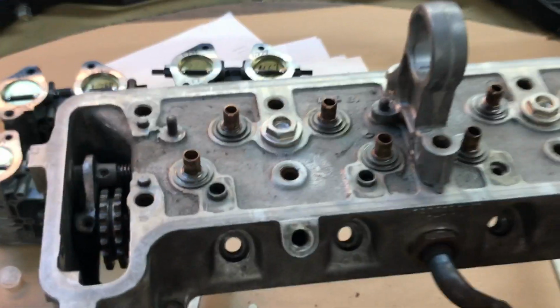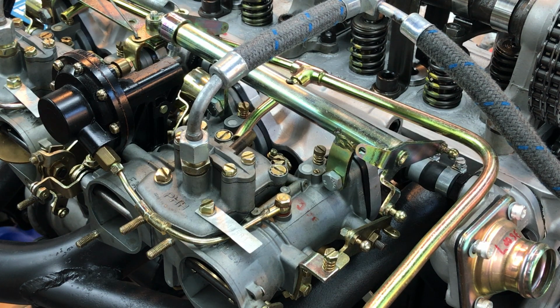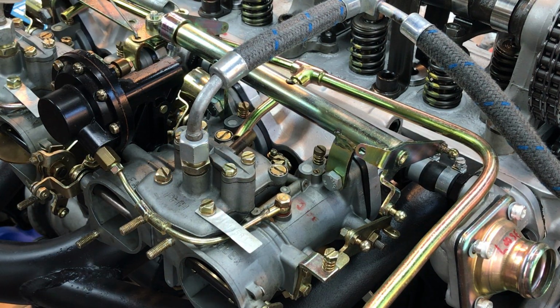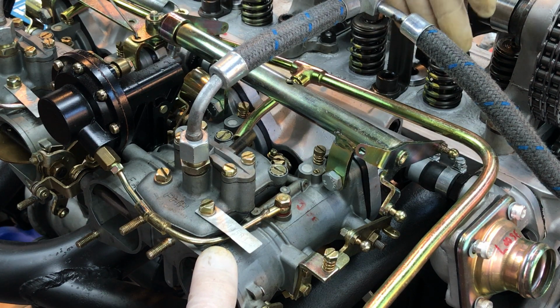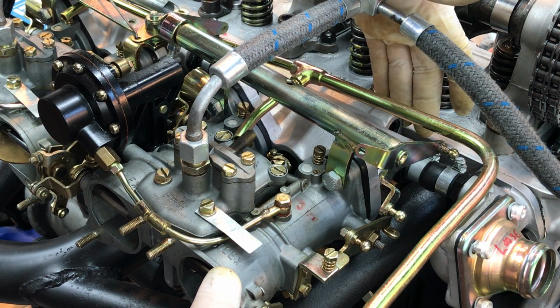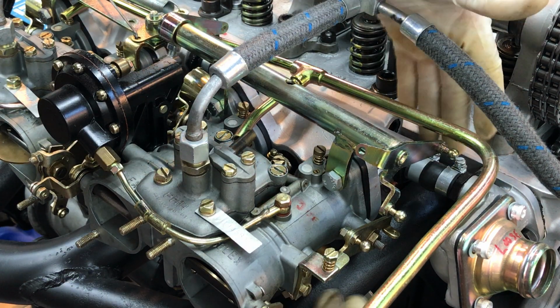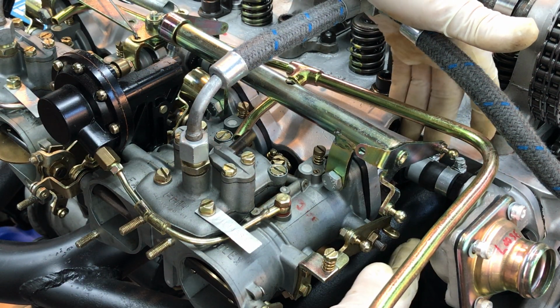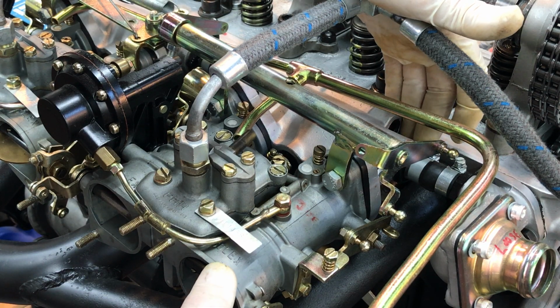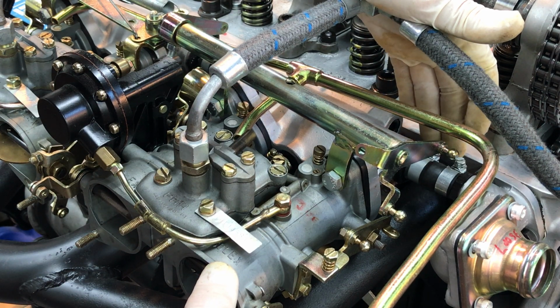Very critical. Now then, let's go over here, and you are having trouble getting the vacuum secondaries to open on this 190 SL in Germany. So let's go through some basics, and I know you don't need these basics, but I'm going to give the information just in case there's other people watching. So what we've got to worry about here is your intake bolted to the cylinder head, and you've got the Siamese intake with the cast iron exhaust, and the problem is that sometimes the common washer holding these together does not produce enough pressure on the aluminum to hold it tightly.